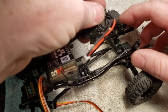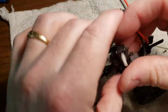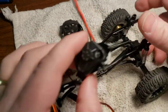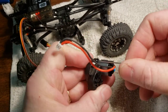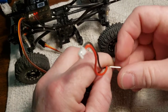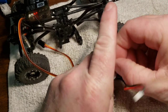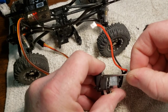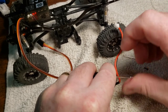Now since we've already undone the ends of the transmission it comes out and I can just pull these off since I previously unscrewed them. The next thing you've got to do is get this cover off because you've got to get the motor out. There's only two screws that hold the cover on — they're on the motor side. Unscrew these. Again, same size screw as before, which is convenient. Don't lose any of them because the ready-to-run kit doesn't come with extra screws.